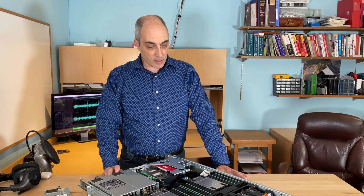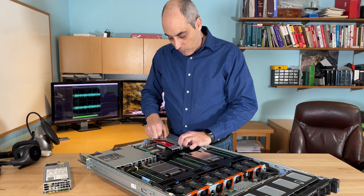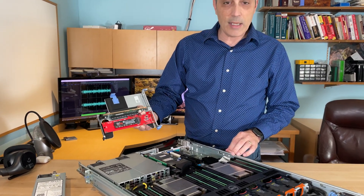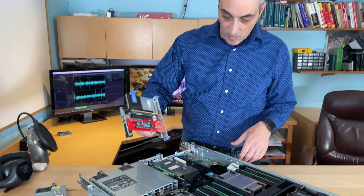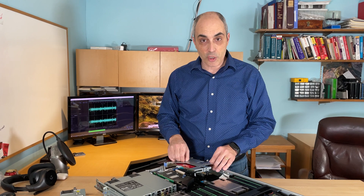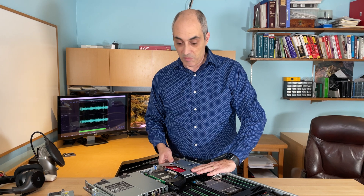For testing environments, if you don't have spare drives or you want something super fast, here's another option: I had a Samsung 960 Pro NVMe drive, put it on an inexpensive PCIe adapter, and installed it here. You'll get a lot of speed at relatively low cost. Of course, this setup has no RAID — no mirroring or RAID 5 — so if the drive fails the data is gone. But if you just want to spin up VMs quickly for testing, it's a perfect approach.